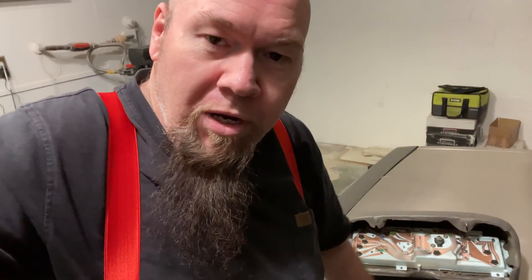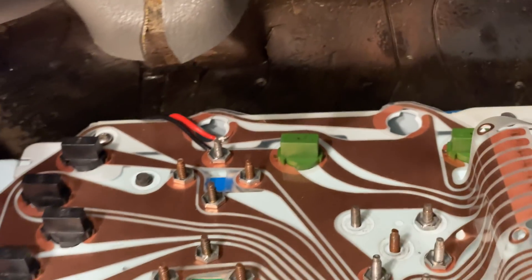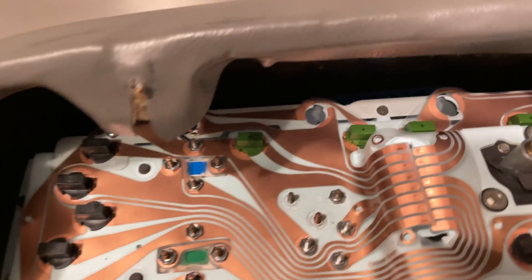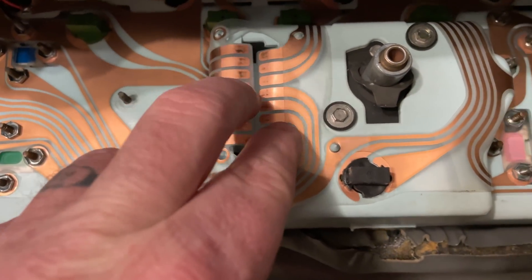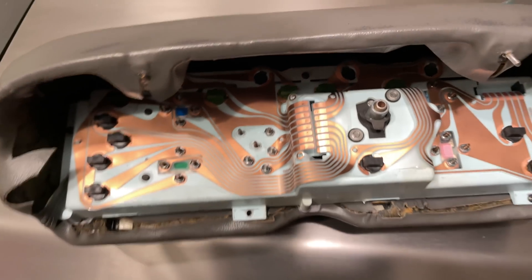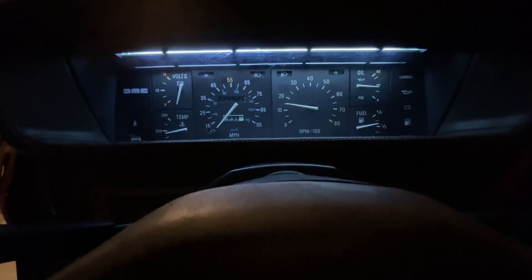For illumination you can use LEDs — there's an illumination socket for your mileage/trip meter and along the top row you could put LEDs. What I ended up doing is taking an LED strip, gluing it in there, wiring it in, and soldering it into place. I grounded one wire and soldered the other on because I tried every which way and that worked best. It's a complicated mess and I'm not happy with how this was designed, but it's going to go back in the car. I turned on the running lights — and look at that, that's how we did the LED strips.